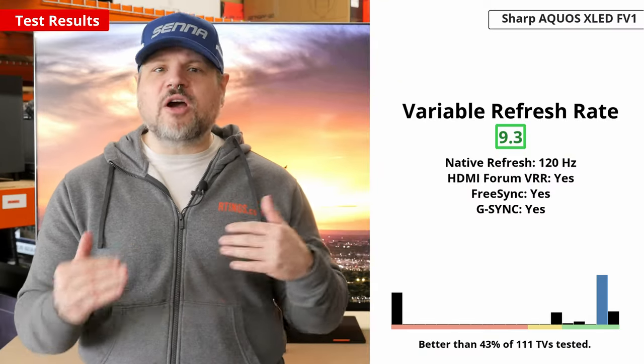That's great, but as we've just said, the TV can't properly display chroma 444 when running at 120 Hz. That's especially problematic if you plan to use this TV as a PC monitor, as subsampling is more noticeable with black text on white backgrounds, which is common on PCs. Furthermore, this TV has weird VRR behavior.